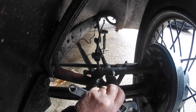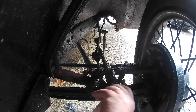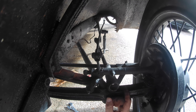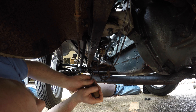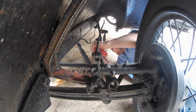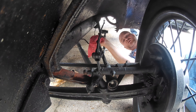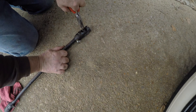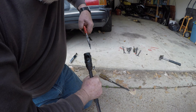I've just got a slot that's got a hundred years of wear on it. I can see the ball, and the ball looks like it's in good shape, so I'm not worried about that. There's the spring — the brake rod is in the way. Turn the wheel and I'll tell you which way to go, because I'm going to have to hold the steering together. Perfect, got it. It really doesn't look bad at all. We'll just clean it up and replace the components — put it back together. The cup and spring is on the inside of the front and on the outside of the back.